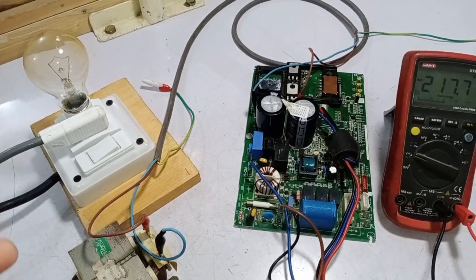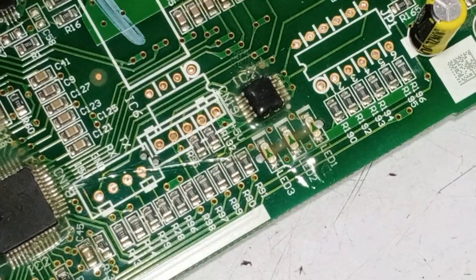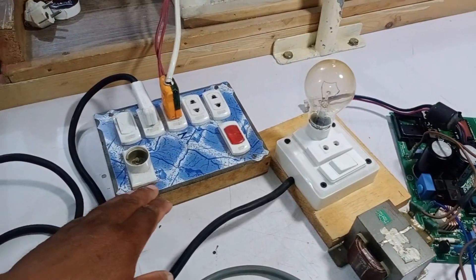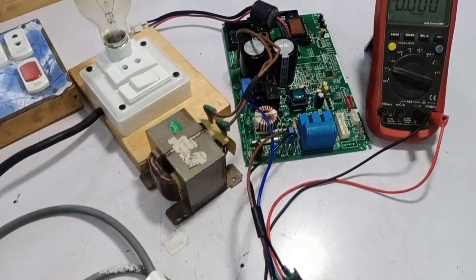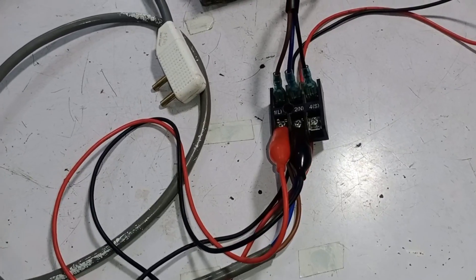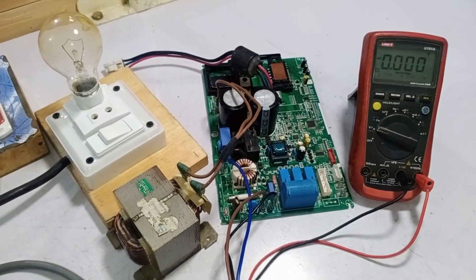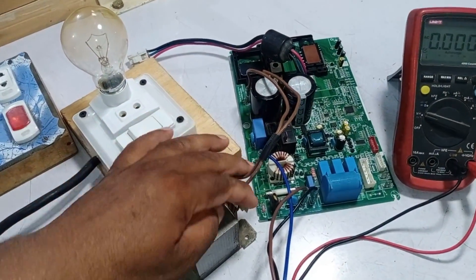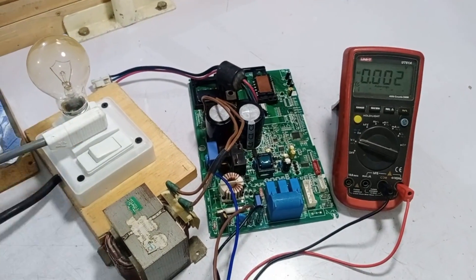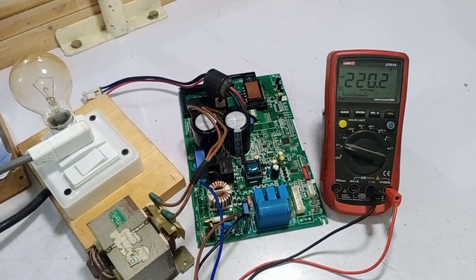Now let me show you how the series board will work with a good circuit board. No light is glowing on the circuit board currently. I have replaced the circuit board with a good one and attached another electric board with all connections in place. The brown and blue wires from the series board are attached to the good circuit board the same way as before. Watch carefully — the reactor wires are attached inside this circuit board. After putting the plug in the socket and pressing the power on button, the voltages increased gradually, the bulb worked and then dimmed out and stopped.